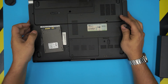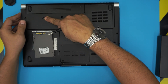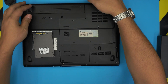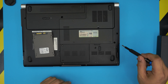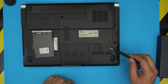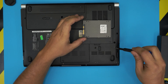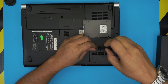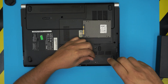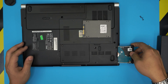Make sure the power is off to the laptop. You do not need to remove the battery, but if you want to be safe, pull the trigger all the way back and then slide the battery out. The hard drive is in this corner — these little cylinder logos right by the screws indicate the four screws you want to remove. They are all the same size and height, so don't worry about mismatching them. Once you remove the screws, simply grab and pull the old hard drive out.